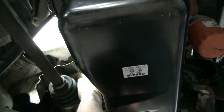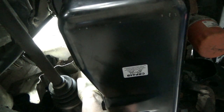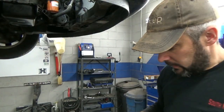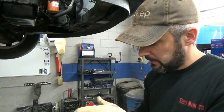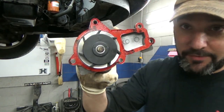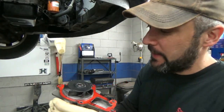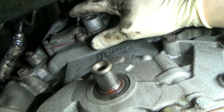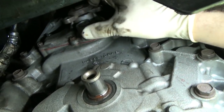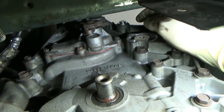They brought that gasket back up. I sprayed it with some high tack, so we'll get ready to see if that water pump can go in without the hub hitting or any kind of interference issue. Here's the gasket — it's the right one, just a little different thickness. I slid it up in there, got it bolted down — if you've got any problems it's going to be rotating the hub. I've got it snugged up, I don't feel any interference issues. It's on, it's tight, torqued to factory specs.